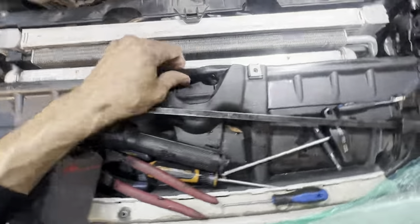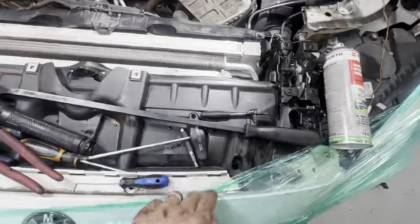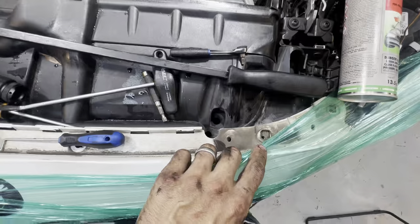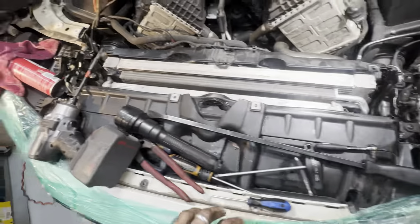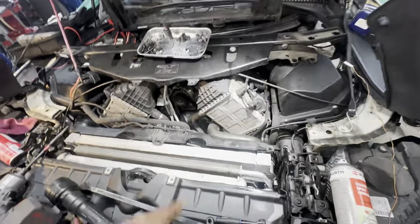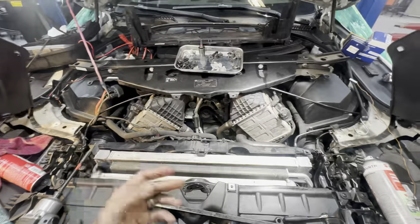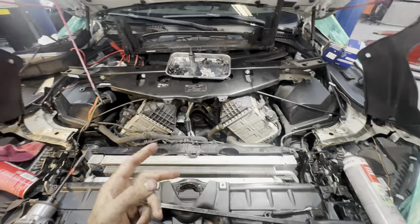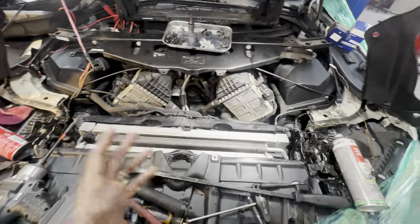One, two, three on this side, and then three on the other side. I took off these bolts along the bumper thinking I had to remove the plastic cover, but you don't have to — so you don't remove those bolts by the bumper, you can keep those on. Now all we do is connect the oil cooler along the bottom, fill the system. There are two circuits in this vehicle so we're going to have to bleed each one individually, and that's it.